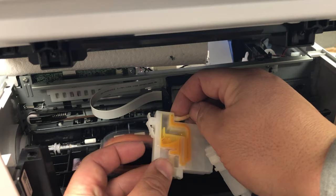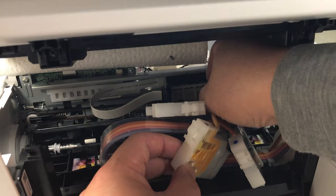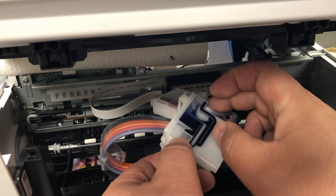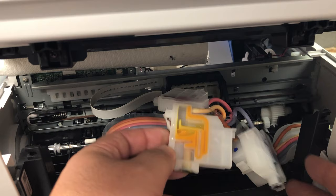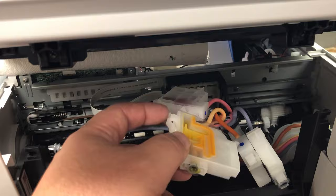There are plenty of ink in the damper, although it's kind of low — about half full — but I don't suspect anything wrong with the damper. Again, there's nothing wrong on the printhead, and probably nothing wrong with the damper. I just stuck a syringe in the cyan damper and started pulling. It's very, very hard to pull anything into the syringe. This is not right.